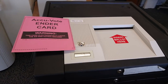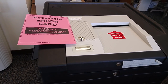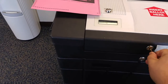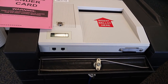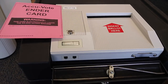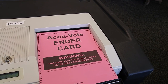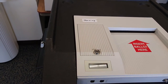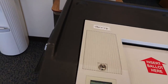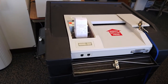At the end of the evening, after all ballots from the auxiliary bin have been processed, it's time to put in the ender card. Usually that flap would already have been down from processing ballots from the auxiliary bin. Place the ender card into the tabulator, press and hold yes and no, and press it in. You should make sure that the tabulator cover is already open when you do that, because the machine is going to immediately start printing the first copy.